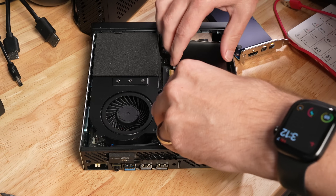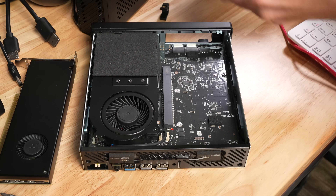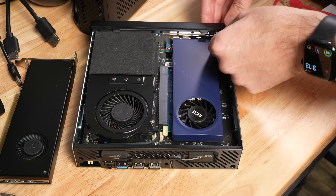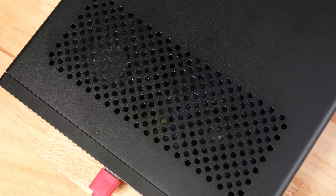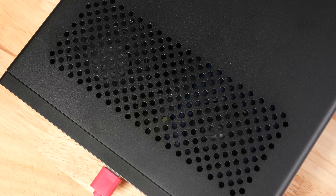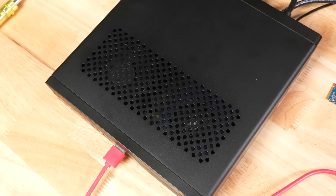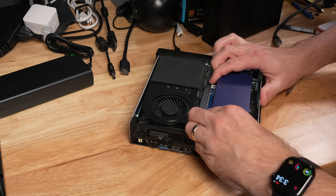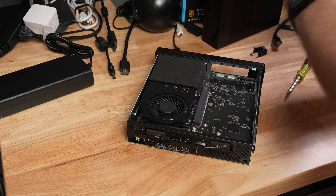Since I couldn't get the A2000 going, I switched back to the original SSD and then swapped video cards over to Intel. I installed this Arc A310 Eco with 4GB of VRAM, and it actually fits better than the longer A2000 board. But when I booted up the R1, even though the fan on the A310 spun up, LSPCI wouldn't see it — that usually means a signaling issue. I've had that same problem with the same card on a Raspberry Pi, and I'll cover that more in a video coming soon on Intel GPUs and the Pi, so make sure you're subscribed.